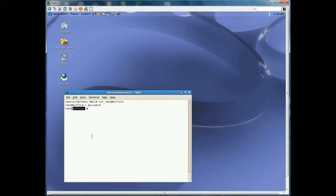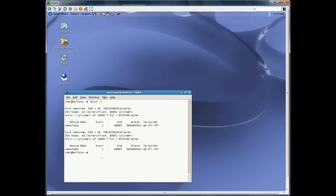I'm going to tell you again — you run the wrong command and you can really screw up your Buffalo. So don't run the wrong command. Don't do this and ruin your machine. Now at this stage we can begin to play around with our drives, because there are some things we need to do to figure out how to set up our drives. The first command I'm going to run on the Buffalo is the fdisk command with the minus-l option — that just says 'fdisk, list out my devices.'